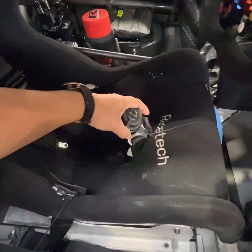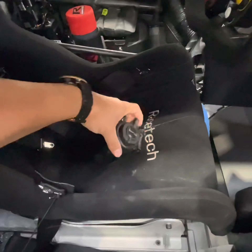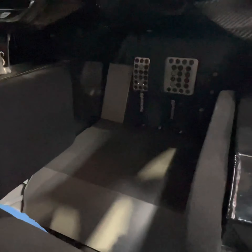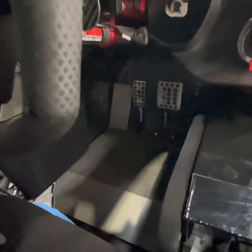All drivers continue to use a six-point safety harness with the buckle on the crotch strap. Turning it to three or nine o'clock releases them. New for the Gen 3 cars are mandatory bilateral leg protection. This padding extends all the way down to the pedal box.